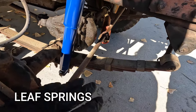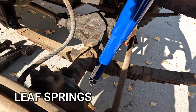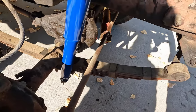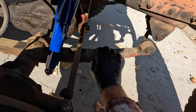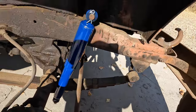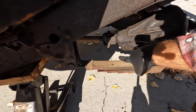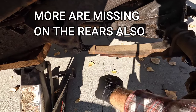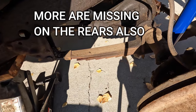As long as we're in here, let me show you the leaf spring situation. They're old and a little crusty but they don't look horrible. You can see the spring retainers — there's one on the front and one there — but on the back we're missing one, which is why these springs are spread out like that. It's not a high priority item so we'll do that another time.